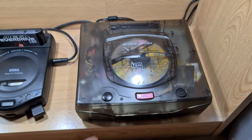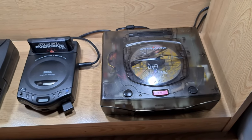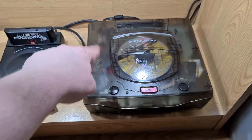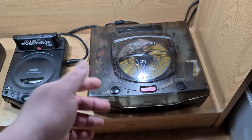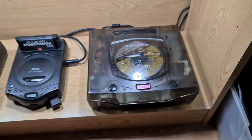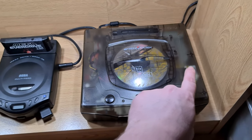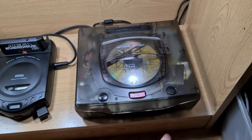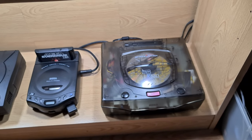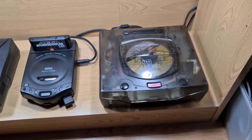This is a Japanese skeleton Sega Saturn — the 'This Is Cool' edition. They did two see-through ones: This Is Cool and a Derby Stallion. I love this one and it was a gift from a friend — can't thank him enough. You can see all the workings. It's got a Pico PSU because obviously it's a foreign system. It's had a recap on the laser. It's got 50/60 Hz modded region switching with reset buttons. It'll play anything — it's got a region-free BIOS and will play any game from any region. It's got a mod chip there, crudely taped. The reason it's taped is that when I had this system before I was having nothing but problems with games freezing and I couldn't work it out. I took the chip out thinking maybe it's the chip — still did it. Turned out to be the white cable.